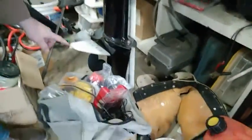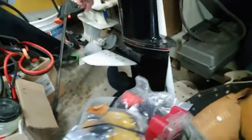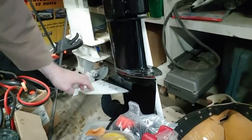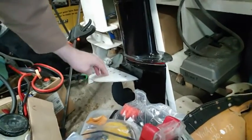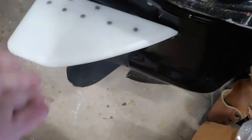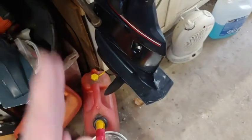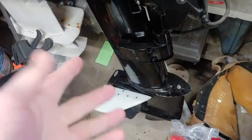While we're down here, look at this — this is an extra fin that I put on. I only put it on one side; you can see I did it on that one too. This is just HDPE that I found. It was that wide, I cut it and shaped it with the sander and popped it on. What that does is it protects the prop. Looking straight down you can't see the prop — there's the prop there. It protects the prop from the rudder hitting it, because on McGregors the outboard is so close to the rudder.